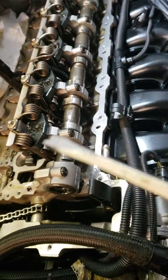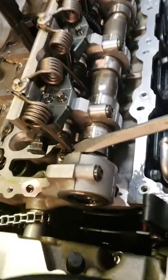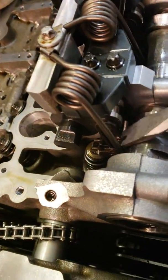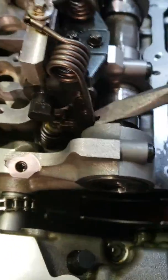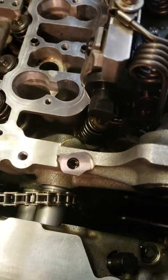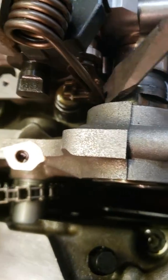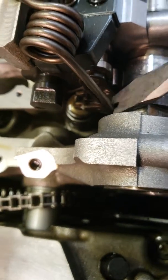What I'm doing is using this to very carefully pry the valvetronic springs off of their seats. You see they lock into the backside of the rocker arms. I'm using the camshaft for leverage and just prying them up, releasing tension from them, then moving them over a little bit to pop them out of their seat.